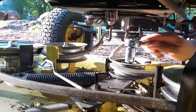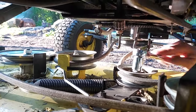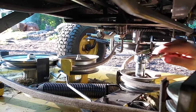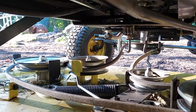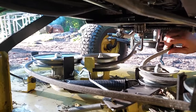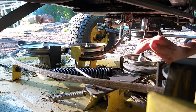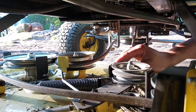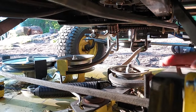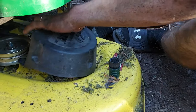I'm going to tighten this guide back down. You tighten it all the way down — it'll get to a point where it stops and you can't tighten it anymore. Now that we've got that all set, you'll see this belt is actually pretty loose, but this metal plate on either side keeps it from falling out. To be completely honest, I think we may have been sold a used belt, but it does work — we bought it at Home Depot, and it works fine. Now we need to put that cover back on. So now that we are all set, we're going to put our cover back on.